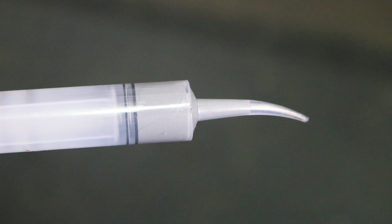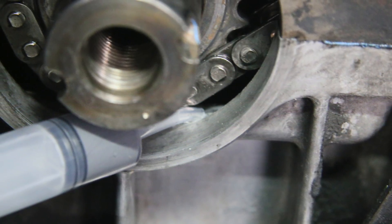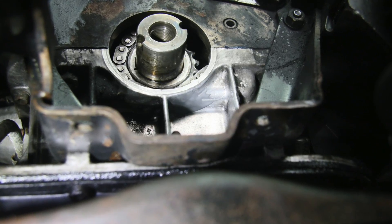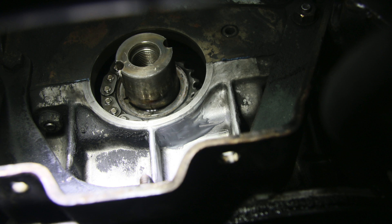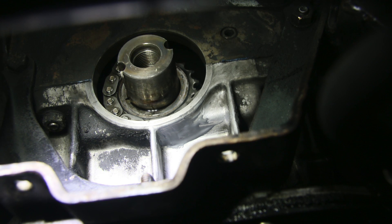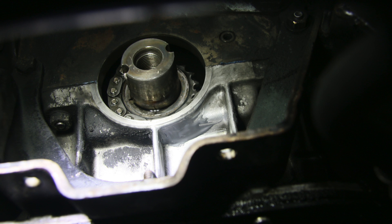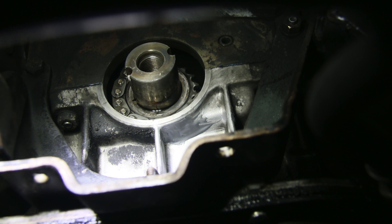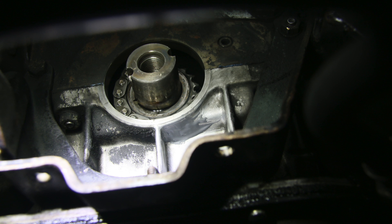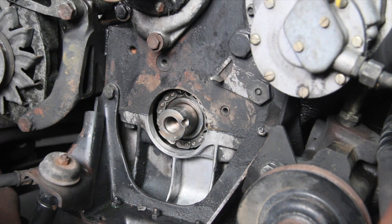I forced the mixed JB Weld into a curved tip syringe, enlarging the hole slightly so the epoxy could come out of the tip. I was then able to work that tip in underneath the timing chain and completely fill the top side of the hole, and did the same thing from underneath. I put a small piece of aluminum in the center of the hole to slow any tendency for the JB Weld to run out. I stayed with this for over an hour, continuously smoothing it until it tacked up enough to leave. It dried smooth, and I believe we now have a very permanent repair.